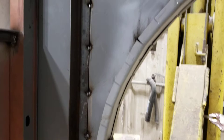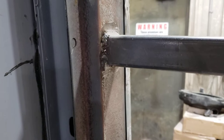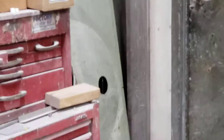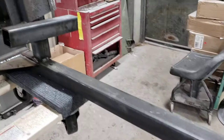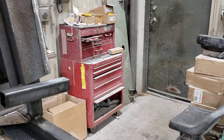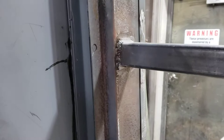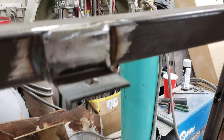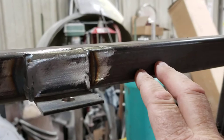We're going to leave this in place. When we were taking this apart, there was a lot of weight that the back of the vehicle actually sat on the rear body panel — you can see that rear body panel over in the corner. That rear body panel was bolted to the back of the truck, and the weight of the truck was basically on it, which was bolted to the end of the frame rails. I didn't think that was a good idea given the weight. So you won't see this because the rear body panel covers it — it sits right over it, just a quarter inch over. We made a couple of gussets, left and right, and bolted that right to the frame, so this rear piece is going to help carry the weight of the back instead of just that rear body panel.